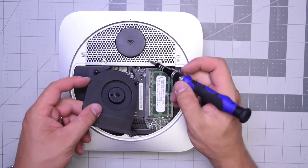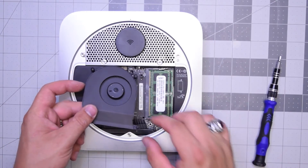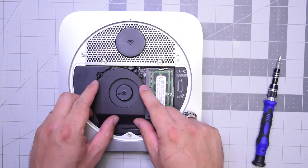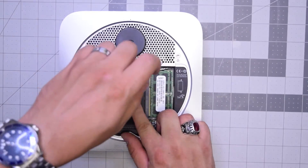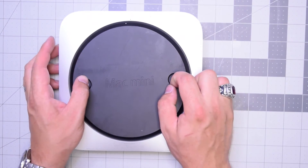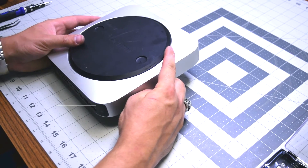Place the fan over the logic board and click in its connector — make sure it's firmly connected. Align it so the long screw on the bottom goes all the way through, then secure all three T-screws. Put the top cover on at an angle first, then twist it into its locking position. And that's it — we're all done. Thank you very much for watching.